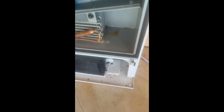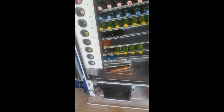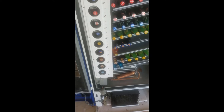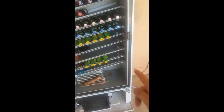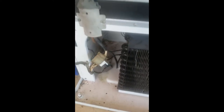I did run into two problems. The first is it didn't turn off the evaporator fan. There's a fan that blows across those coils and keeps air moving throughout the compartment, and it still ran. I turned off the compressor using the Wemo, but the fan inside still ran and generated a lot of heat. I put a thermometer in there and it was over 100 degrees — that electric motor running in this sealed refrigerator was a problem. So I had another Wemo laying around, cut the cable, used an extension cord, and put a Wemo in-line with the power supply to this fan.